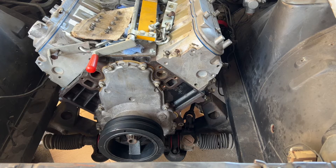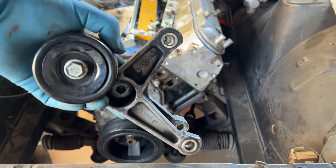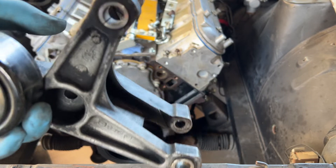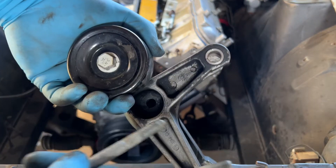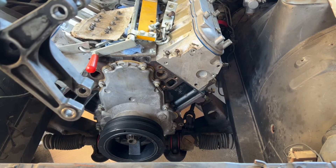On to the next piece of business — I'm trying to figure out how to set up the alternator and I have two different ideas. I'm going to be using this F-body alternator mount here. What I've seen is that most people use it as a low mount, which is basically going to be held up by the bottom hole and this top hole, so the middle hole isn't going to be used for that.